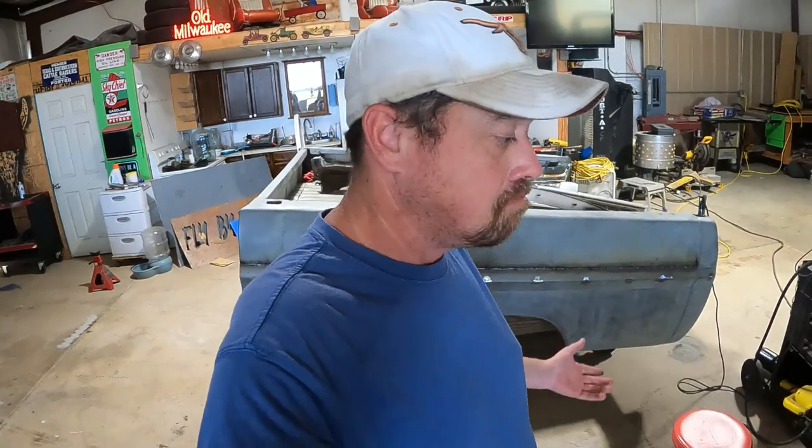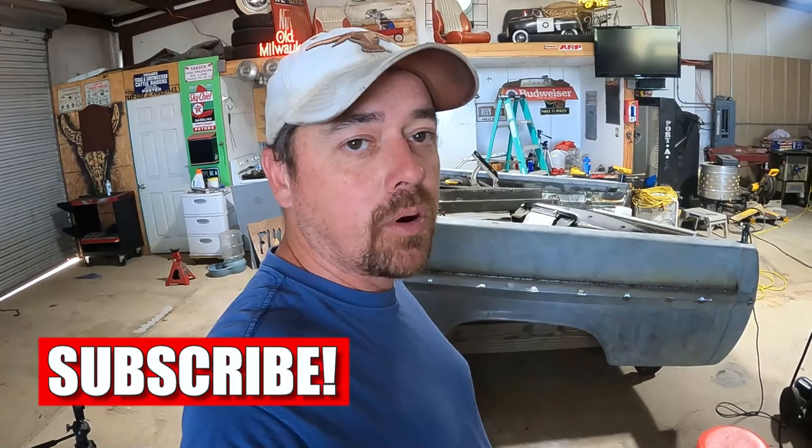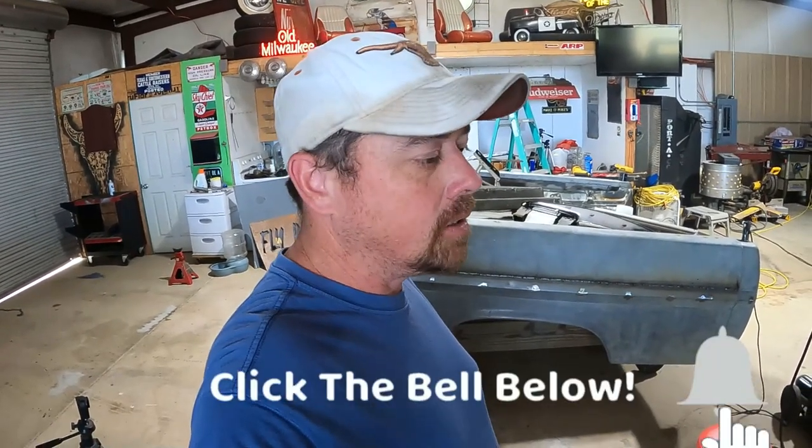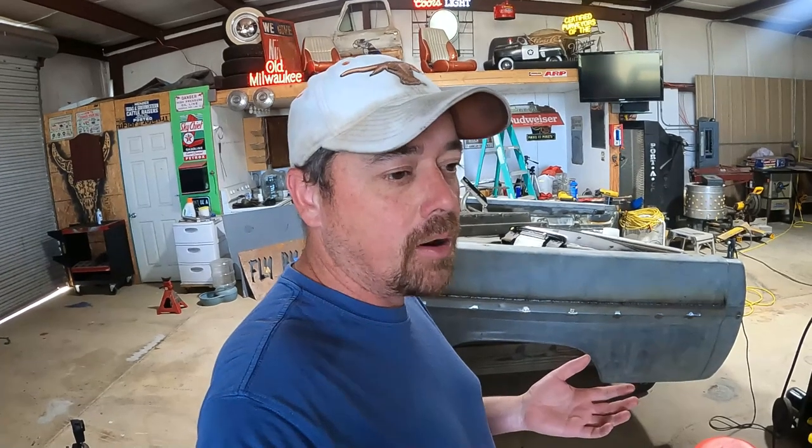And then we'll start working on the worst product that I hate the most, and that's Bondo. So don't be like me. Don't buy the cheapest Bondo you can find, which is the Bondo brand Bondo, because when you mix that stuff up, you only have about 3 minutes before it gets hard, and so you have to be careful about the amount that you mix and how far you're going to work with it. I like putting mine on super thin. That way I don't have to worry about sanding as much of it down.